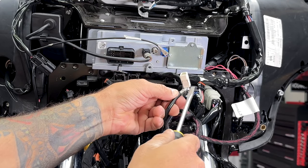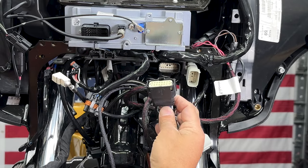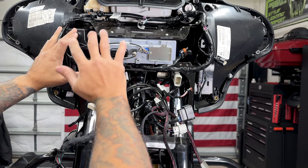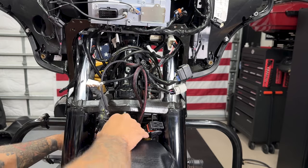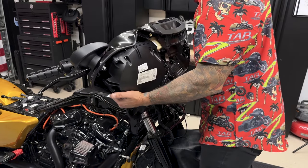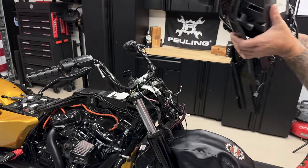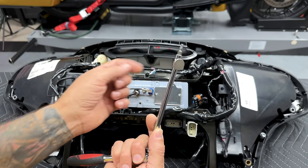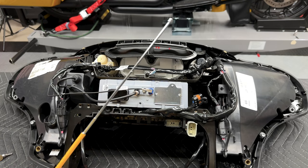You have your GPS antenna — you don't need to disconnect that. I'll remove the right and left main-to-fairing harness connectors. I'll look over one more time to make sure everything leading down towards the neck area is disconnected, then tuck these wires back so nothing gets snagged, pulled, or damaged. Now I'll slowly pull back on the fairing to take it off making sure nothing is getting snagged. A trick I use so I don't lose screws inside — I take a magnet, stick it on, and it magnetizes your bit, or use an extendable magnetic stick to pick out your screw.